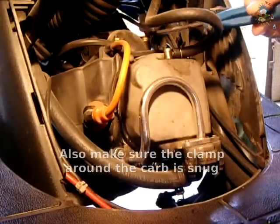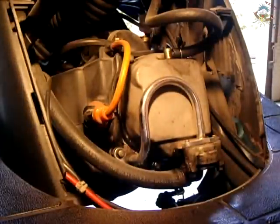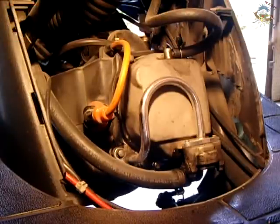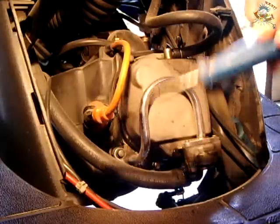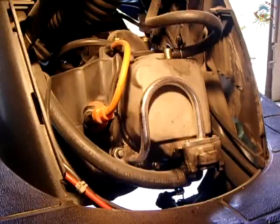Once the cover has been removed you will have full access. Right here is your intake manifold — inspect it, make sure the bolts are tight, make sure there are no cracks. You can also pop off your spark plug boot, take out your spark plug, give it a cleaning with maybe 600 grit sandpaper between the contacts, readjust the gap and reinstall it. Also check to make sure your hoses aren't dried out or cracking. I replaced all the rubber lines with Gates and Goodyear hoses since the stock hoses dry rot and fall apart.